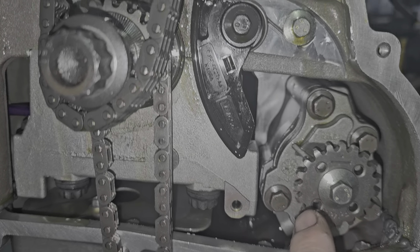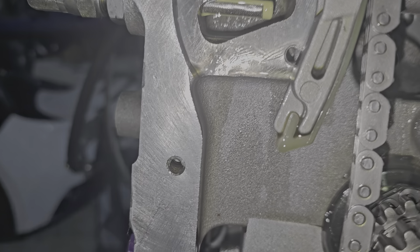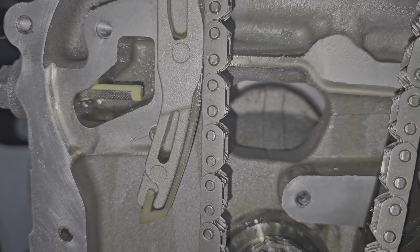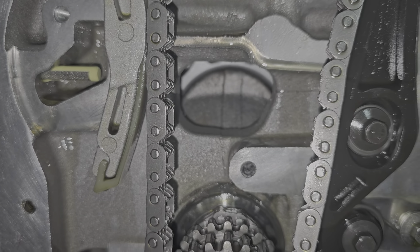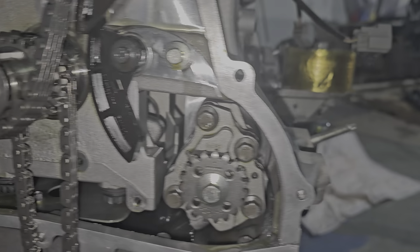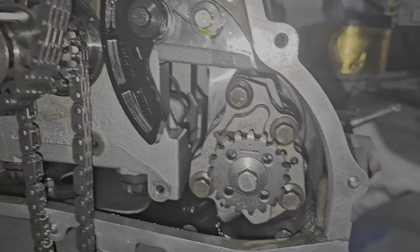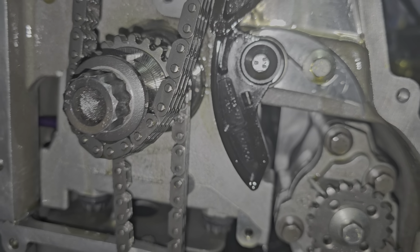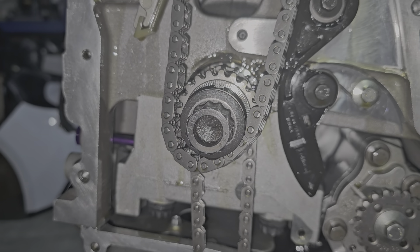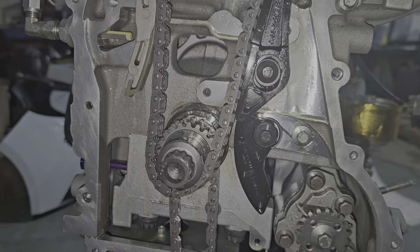It'll start coming out right here, and that's when you know it is purged or primed — there'll be no gap in between. I also filled my oil filter, but there was about 10-15 seconds where there was no oil in the system, and then it started pouring out really good. That's when I knew my system was primed.